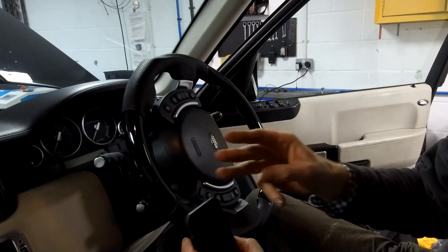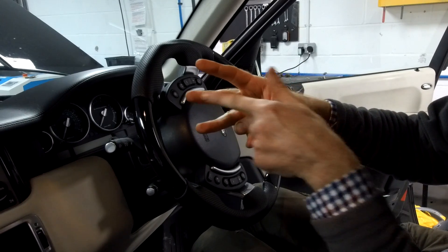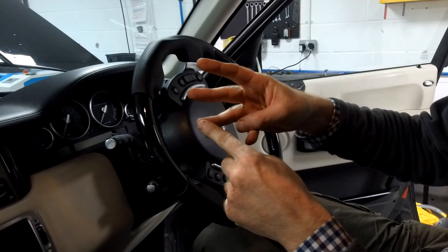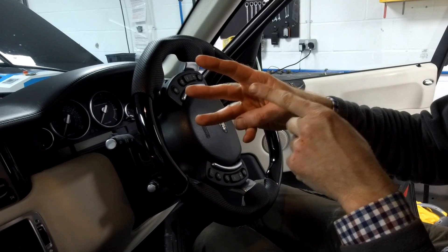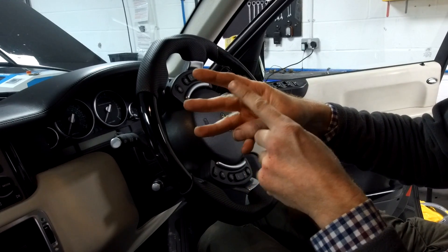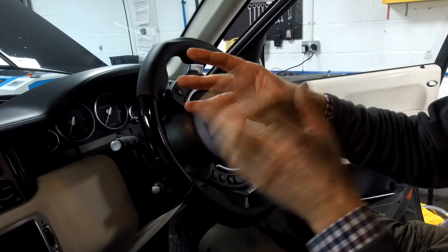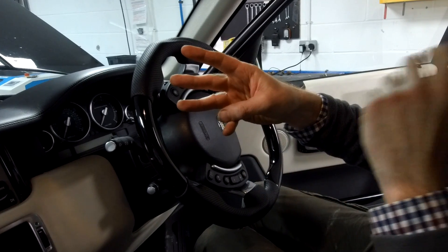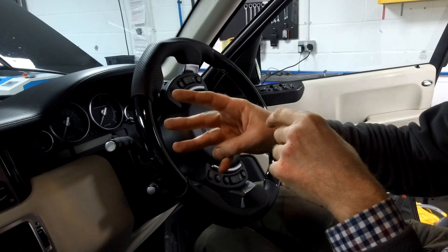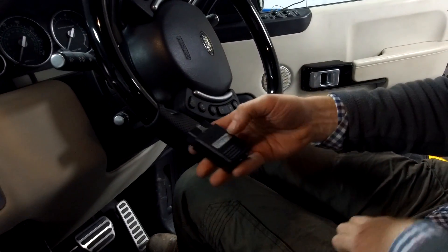So you've got three modes — if my fingers represent: this is the raise mode, this is the normal motorway driving mode, and that's the access mode. So if you reprogram it with the IID tool, you can lower them but all three will shift down, or you can raise the calibration but all three will lift up. You can save different profiles — so we could create a low cruiser profile and a big truck stance profile.